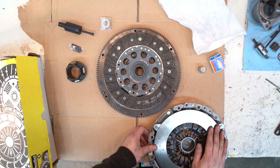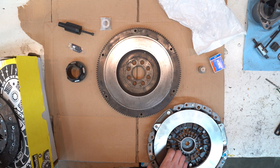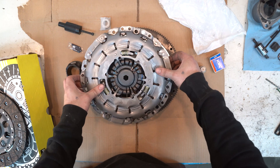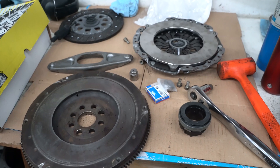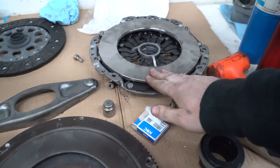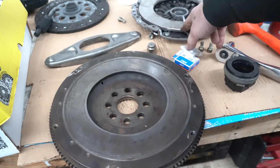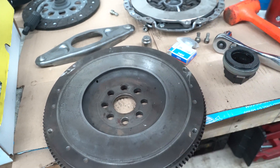Something's not right here — this is sitting above this. So it looks like I'm at a standstill now. The clutch I ordered for the six-speed, the holes don't line up with the M20 holes, and that's irrelevant anyway because the flywheel that this six-speed clutch is made for has a recessed surface, so the M20 flywheel won't work at all.